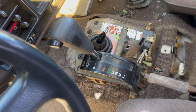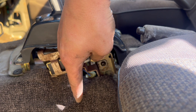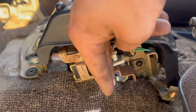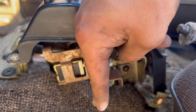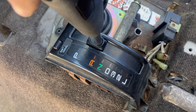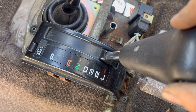I think that is the money shot right there. Basically, there's a lever that comes off this pivot - when I shifted the lever back, it moved too much, so in between park and reverse was actual reverse. What I did is move the lever so it sits neutrally in this position. When I move the shift lever, it moves less distance because you're also going down. Let me demonstrate - that's park, that's reverse, neutral, drive, three, two. It kind of works.